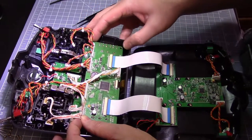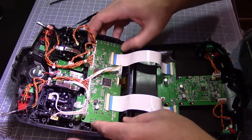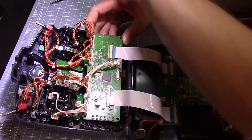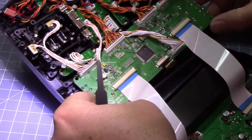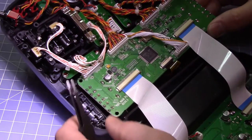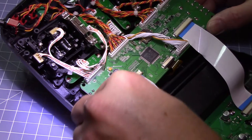What happens with the buttons is there are two contact points, and they break loose over time. I'm just going to glue it back on. It's important to note that the first time I did this I just slid it back in place, put it all back together, and it worked for a day and then popped right back out. So it's important to glue it back.